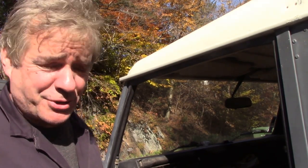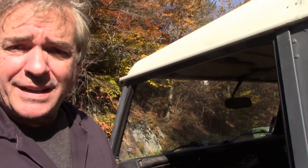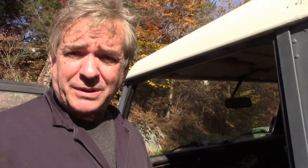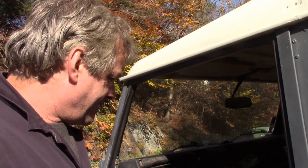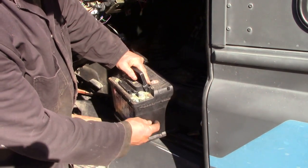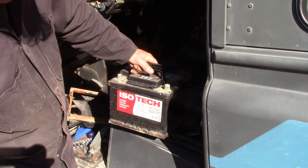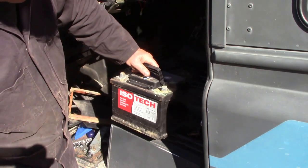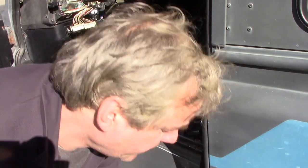The problem with the battery is it's been left all the time with the battery in through several winters. Even in a garage without snow, when it's minus 30 and these batteries have got no charging, you might as well throw them out because the plates have buckled — they're finished. A sign that the battery's frozen is the sides have bulged, especially the ends. It doesn't look a very old battery, it's obviously come from France. Scrap — let's put a proper battery on.